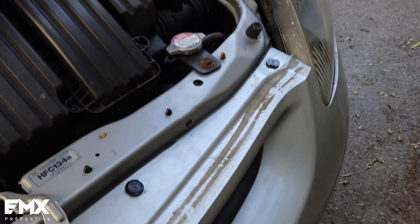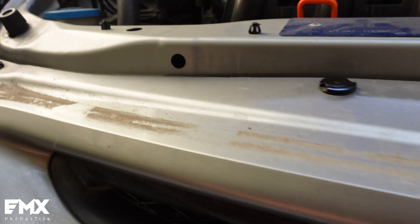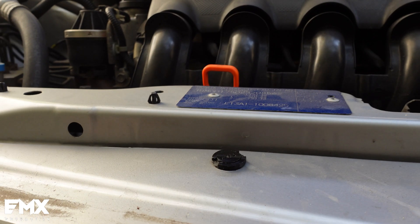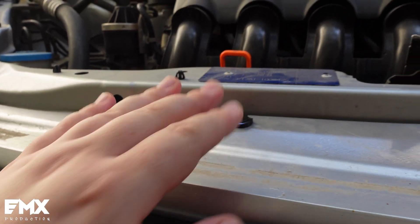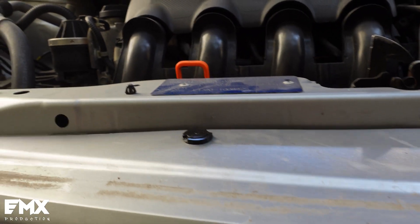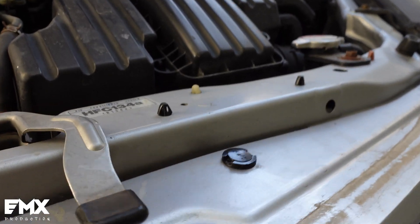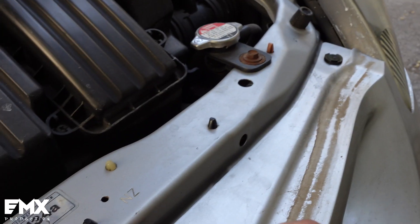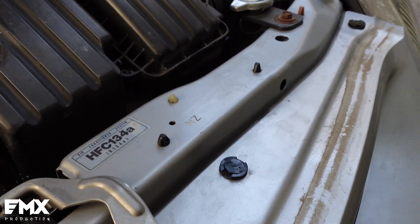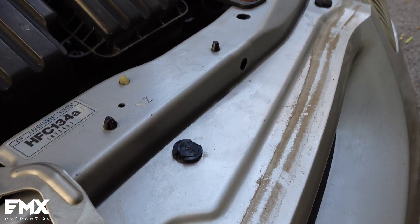As you can see they're installed. Of course they're gonna work better if you print them from ABS or ASA. We're gonna see how much the heat extends here, because this is in front of the engine — maybe just from the air coming through the gap they will not deform or break. The reasonable thing that may happen is from the heat they may become fragile and eventually fall off. They are made for a 10mm hole for the bumper, and they will be available for free — just check the link in the description to download them.